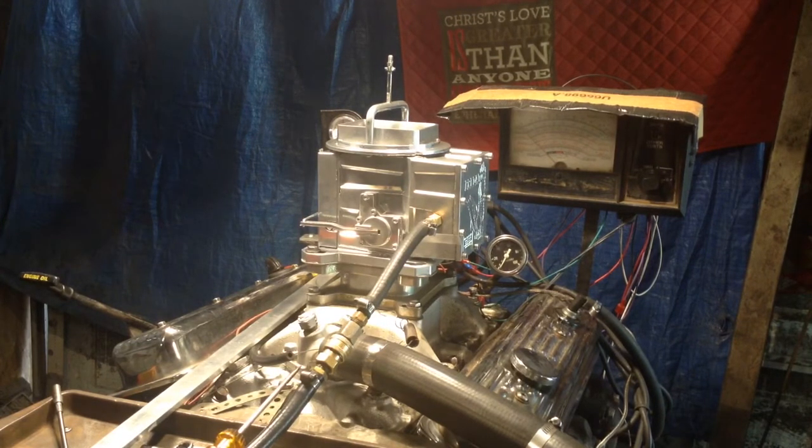Now these carburetors — you can't get any new ones anymore. There's been a major change in situation at Predator, and Dale and those guys, they're just not making them. But we're rebuilding them when we can get parts. This one here, some guys call this the PIXI, which stands for Predator XI, which means it has the extra idle circuit.